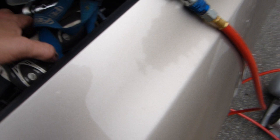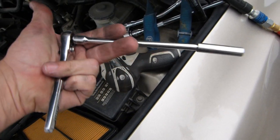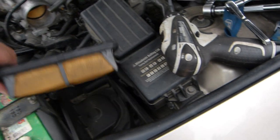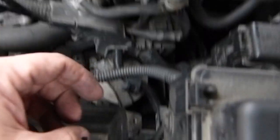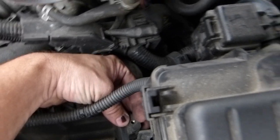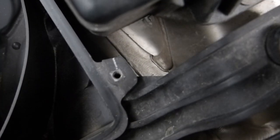And to undo those 4 screws in the corner, you either need a screwdriver with a long Phillips number 2 bit, electric or whatever, or you need a socket, an 8mm socket in this case. Works magic. Now the 4th screw here will be difficult to access from up top when the airbox and the accordion part of this ductwork are in the way, but you can put your hand underneath, reach the bolt, get it started, and then get the wrench and tighten it that way. That one's fairly easy. This one is the absolute easiest to get to, and that one is also relatively easy.